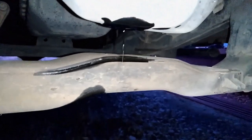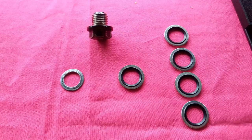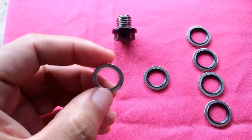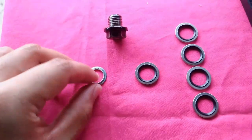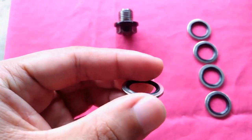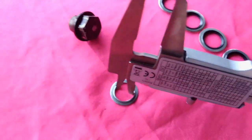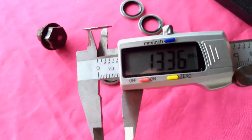Leave the vehicle overnight to completely drain the oil. This is the old washer I removed — this is what you call the sump washer, which is made of aluminum and is single use only. This other kind is what you call the bonded seal oil washer, composed of a rubber gasket and galvanized steel. The inside diameter of this aluminum sump washer is 13.36mm.